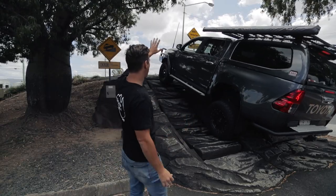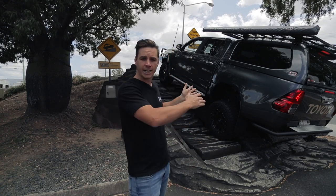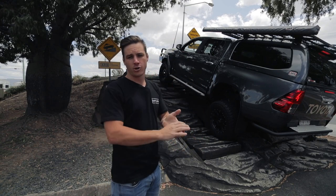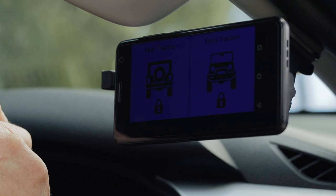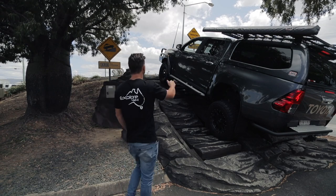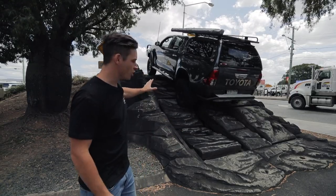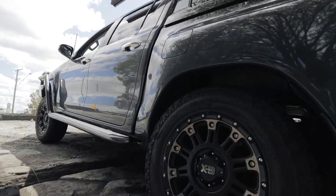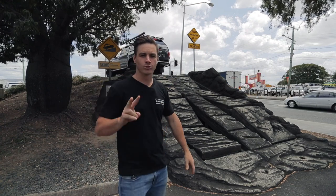Hold it there. Now not only could you go back and hit this with more momentum, but chances are you're going to bounce all over the track — front wheels in the air, potential to break things or run into things. So throw the front locker on. Now we're going to engage two lockers and look at just how much control you now have over this vehicle. Up you go — nice and easy, no wheel spin whatsoever, straight up. As I always like to say, have a crack in grandpa mode, and if you don't make it you can always go back and have another go. Full control, two lockers, proper four-wheel drive — you cannot beat it.